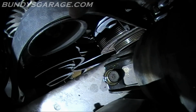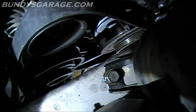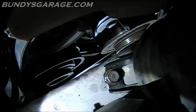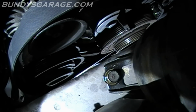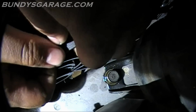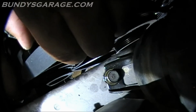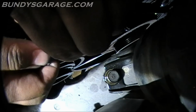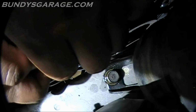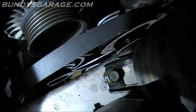Okay, right here, just lead the belt with the alternator around the back side of the AC compressor and on the back side of the crankshaft pulley. And we'll tighten it up using the alternator. I'll leave the alternator off first. Bring on the AC compressor. Don't worry about it here on the top. Duh, might help if I took it off the adjusting nut.